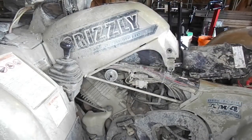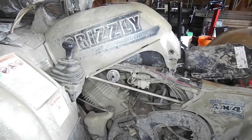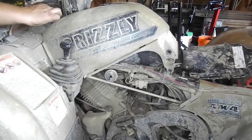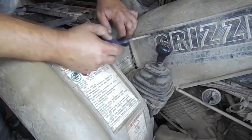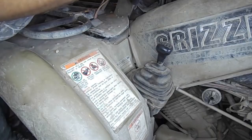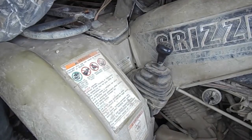Once the two bolts are removed, again, pop loose the plastic that wraps around the front display. Again, this is only held in by plastic clips, so you should easily be able to loosen it. Once loosened, pull back on the plastic slightly, and you will see a Phillips head screw on both sides of the display holding the plastic cover over the tank. Remove both of these Phillips screws, and then the plastic cover will lift off the tank.